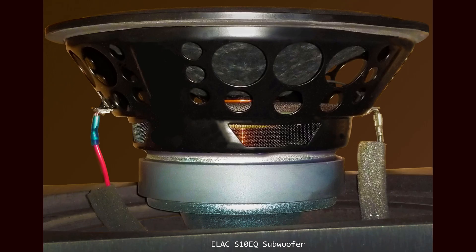The speaker looks great — it has good wires, solid attachment points, and very tough cone material along with the rubber surround. The magnet is very large, about five and a half inches across by a couple of inches or more. The voice coil is really big, and you can see at the bottom of the basket the screen in front of the vents for the spider, which locates the cone at the top of the speaker — that allows pressure to equalize when the speaker is moving. The circles on the basket are there for the same reason older race cars used cutouts on metal: to save weight while retaining stiffness. My guess is this method spreads stiffness more smoothly over the surface, but I'm not sure — I do like the way it looks.